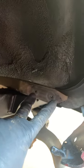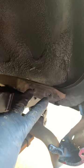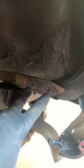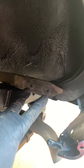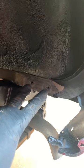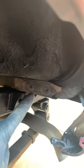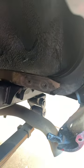In the meantime, I've got to try to get these mud flaps on. Those two bolt holes — no matter what I tried, I drilled them, tried easy-outs, heated them until they literally started to melt — I couldn't get those broken bolts out. So I just drilled them, tapped them, and got some new bolts. I'll hit that with some primer and paint since I burned it off trying to heat those out.